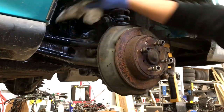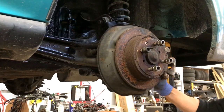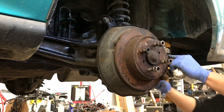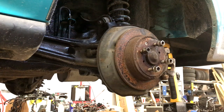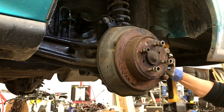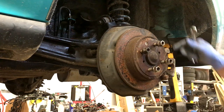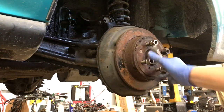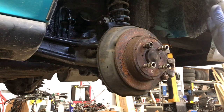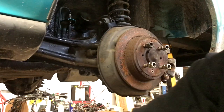Shouldn't breathe too much of that stuff in. Let that dry for a while and I'm going to pray the brake bleeder cracks free — move my bucket over. The reason I had the calipers semi-off was to make sure they spun back, and they do. Use a 10mm to crack the bleeder — if it doesn't crack it's time to cry. It cracked and fluid is already dripping, so we can gravity bleed this and give it a couple final pumps. I'll throw the pads back on, get it in the shop, and turn the rotors on the on-car lathe so it's true to the hub. Then just run the e-brake cable — super easy on this side.